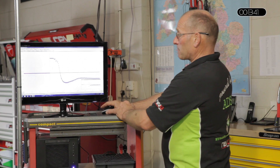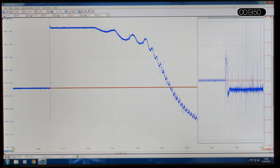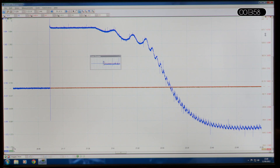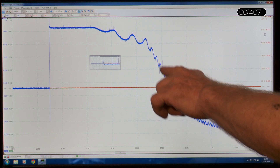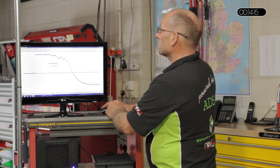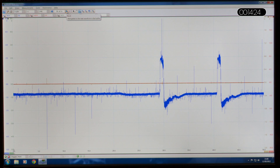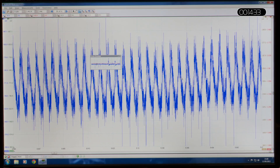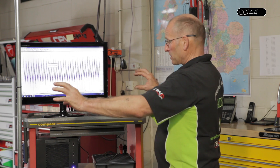There are a number of interesting features. If we expand into that image again — we have quite a high sample rate, so we can zoom in several times — the detail is quite amazing. We're actually looking at individual engine intake events as seen electronically through the MAP sensor. This gives a great deal of confidence that the actual sensitivity of the component is good. Going back to the full image for the next frame — we looked at smooth idle, that's what we expect to see. Nice smooth engine, nice smooth signal from the MAP sensor. Zooming in further, individual events and individual turbulence in the manifold, which should all be smooth and symmetrical — which indeed they are.